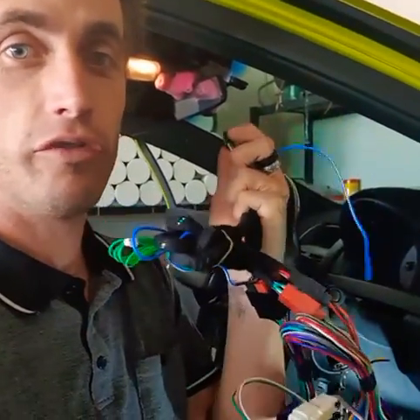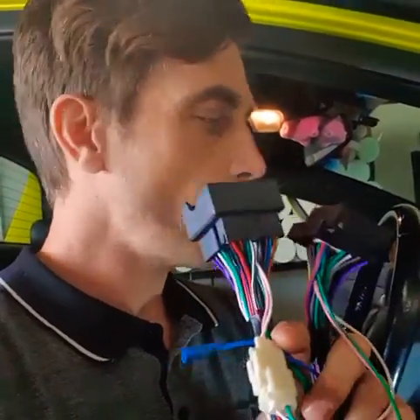The reason this is unique to Universal Fuse and you can't buy it off the shelf anywhere else is that we actually modify some off-the-shelf components to link up this plug-and-play kit for you. It has a standard T-harness for the VE Commodore in this case, where one end will plug into the factory audio unit and the other end will plug into the factory power harness and speaker harness that came out of the audio unit.